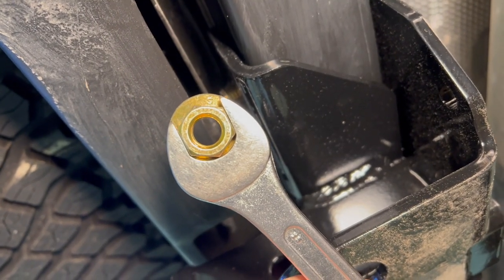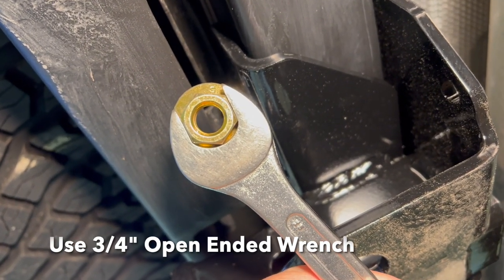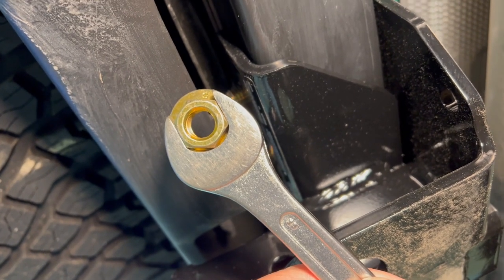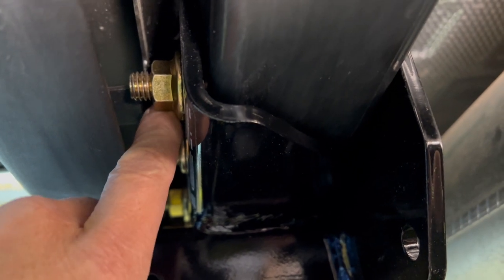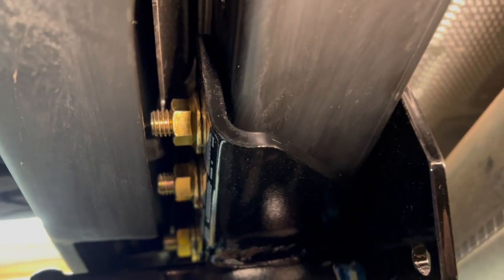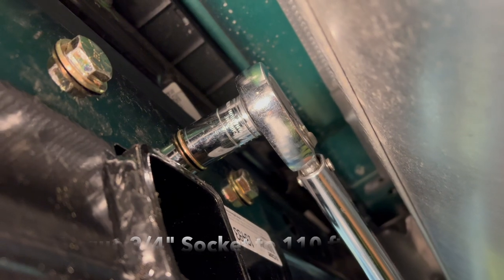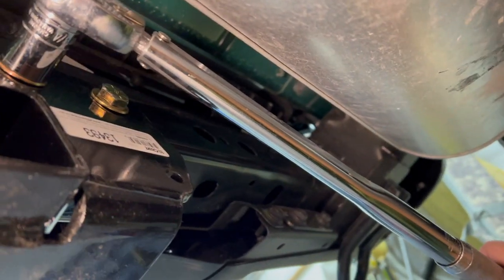This shows the clearance of the bolts on the back side. I'm going to take those collar nuts and thread them on. Clearance for installing the outer nuts is really quite tight, so you're going to have to use the open end of the wrench to hold the flange nuts into place. I'll put that into place and tighten it up hand tight. We've got all four of those bolts hand tight. Now we're going to use the torque wrench and torque these to 110 foot-pounds. Be aware that 110 foot-pounds of torque is a lot — you're going to need to use a real torque wrench to get there. You're not going to be able to do it with a short wrench.